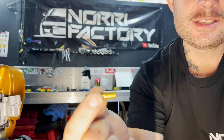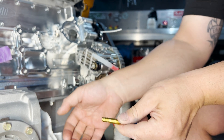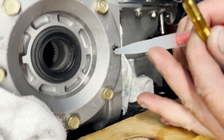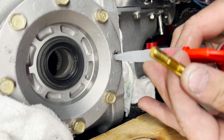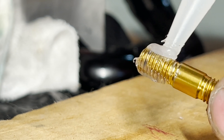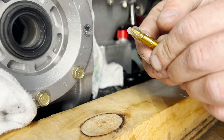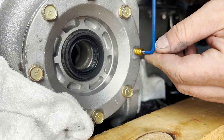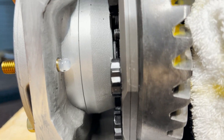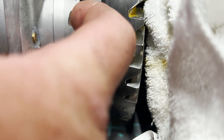This is our M8 stud — I think it's a 4mm hex head. We can put a fair bit of silicone on, even an excessive amount, because we can wipe it off on the inside. I'm going to put a little bit of silicone in there first, wipe it around the walls, then add a little to the thread. We really want it to seal. Now gently poke it in, and on the inside you can see where the silicone has come through. Just smear it over the top of the head of the stud rather than wiping it off completely.